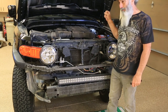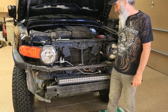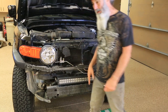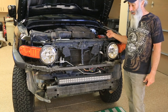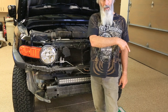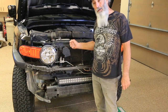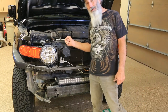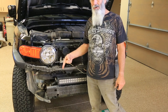So we got a total of 12 10-millimeter bolts down below and three of those little push connectors up top, and the bumper comes off plain and easy — you can do this out on a trail if you need to. Hit subscribe, hit thumbs up, and keep watching — we've got more coming. To put this back on, just follow the steps in reverse.